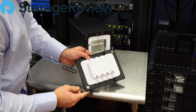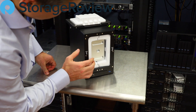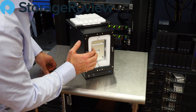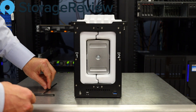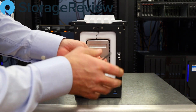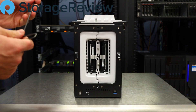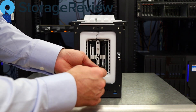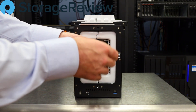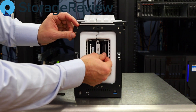The door itself is heavy — it has fire protection and is held on with magnets, which is neat. Inside, there's a little bank vault door with indicators for disc one and two so you can keep track of those. In the world of IOSafe, fireproof means it can sustain 1,550-degree temperatures for 30 minutes — that's the ASTM E119 spec. For water, that means a 72-hour submersion 10 feet deep in fresh or salt water, which is IP68. So that's three days of water protection.